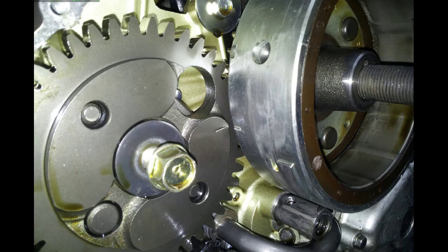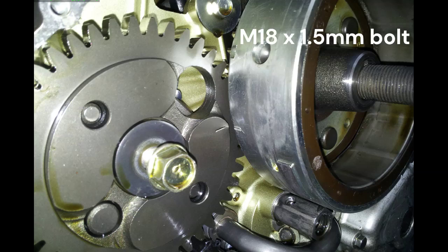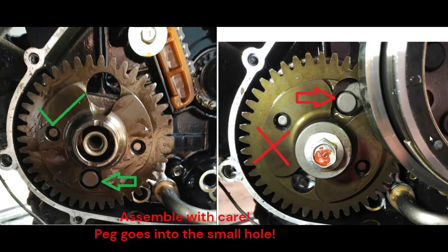The balancer shaft is gear driven and it has rubber bushings that can go hard and produce a knocking noise at takeoff and acceleration. You can find a video about that on my channel. It is not super difficult to replace those rubber bits, but you're going to need a flywheel puller, which is not a special tool essentially, because if you can go to one of these DIY stores where you can buy random sized bolts and such, all you need as a flywheel puller is an M18 by 1.5 millimeter. So that's M18, that's the thread size, and 1.5 millimeter thread pitch. It's a big bolt. You can just screw that into the center of the flywheel, once the flywheel retaining bolt is removed, and you can use that as a flywheel remover.